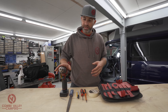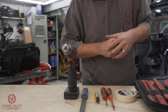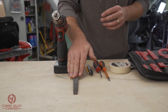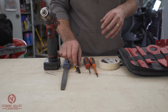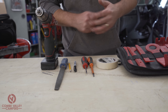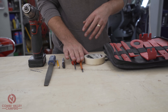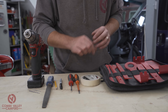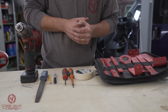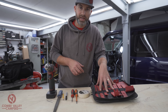The tools you're going to need to fit curtains into your campervan are as follows: a drill with a two and three mil drill bit — maybe even double up on your two mil drill bits because they're very easy to break. A file for modifying bits of plastic trim if you need to. A form of marking — we have found a pencil and a pen to be useful. A small Phillips screwdriver that is going to fit the screws provided with the kit, and some tape for either masking off sensitive areas or as an aid to marking holes. And finally some trim tools to help you prise off or remove plastic trim in your camper.